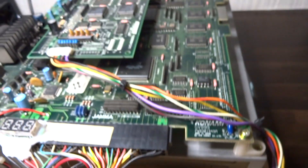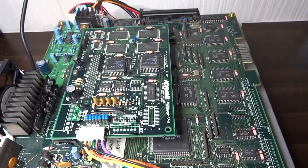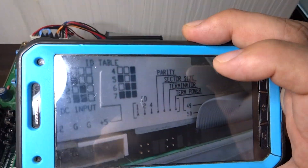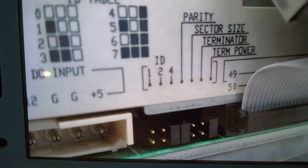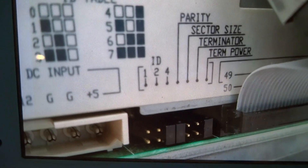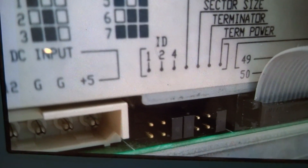You'll notice this uses a CD-based SCSI drive. Pretty much any SCSI drive will work for this system, but the biggest problem is the jumper settings. I had to do some hit and miss to figure out the right pattern, but I'll share that with you so you don't have to go through the same trouble. The jumper settings are: ID 4 is on, parity is on, and term power is on — all three of those jumpers needed to be on in order for this to work. ID 2 didn't work, ID 1 didn't work — it had to be set exactly like this.